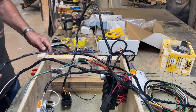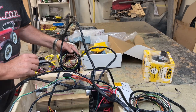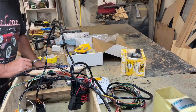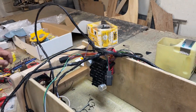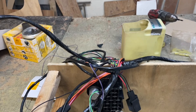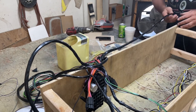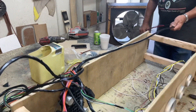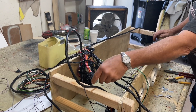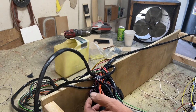I've got the dimmer switch, and all this goes to the rear for your tail lights, fuel sending, and all that — it's all in that harness. You get the kit and it comes in one big bundle, so you pretty much separate left from right knowing what you want. I'm going to neaten this up. This car has the Sniper EFI, so it's got wires for the fuel pump and all that. It'll all hook up right here — there's already a 12-volt fused circuit for the fuel pump and the Sniper kit.